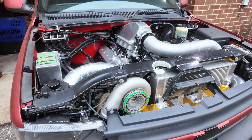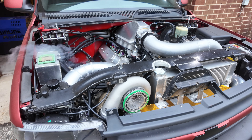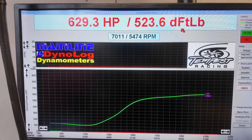So we're at 10 — let's go to five — and let's try it again. All right, 630 horsepower, the graph looks great, and we still need to add some fuel. So that's okay, but at least we're in the ballpark now. Not bad for five pounds of dome pressure, graph looks great. I think one more at this boost level and then we should have the fueling straight, then hopefully it just got turned off a couple times.